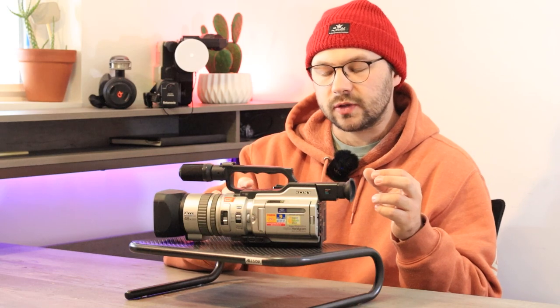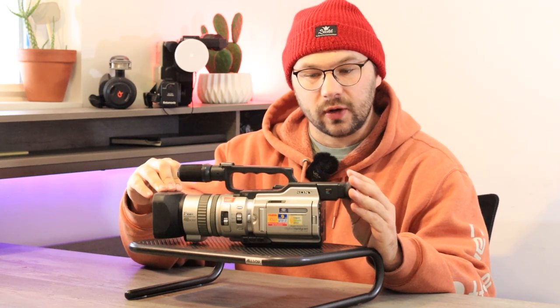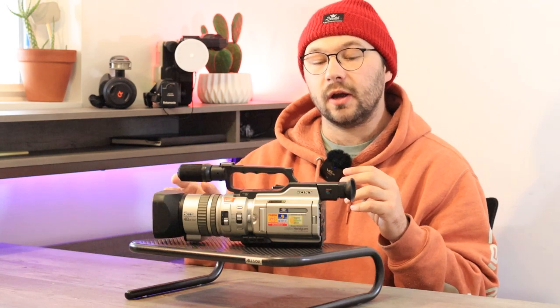If you're new to the tape camcorder world, you may not know what going tapeless means. There are converters you can buy. You plug into the video out sources on your camcorder and it records the footage playing on playback from the tape, straight to an SD card. This only works with S-Video and RCA plugins like the red, yellow, and white out sources. It also recognizes the signal in record mode — it acts as a monitor, and whatever the camera sees, the device will see. So if you have a broken tape deck or just don't want to bother with tape, this is a much faster way of doing it.